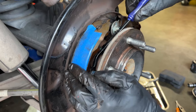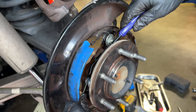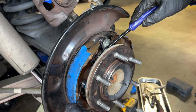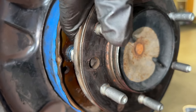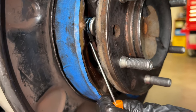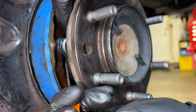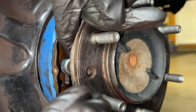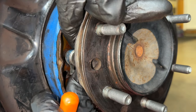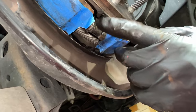I got it in. I put the pin and spring assembly in with my pick tool and then pull the tool out — it's in there. Now that the spring is in position on the shoe, I grab the hook of the back plate, push my index finger against the spring assembly so it doesn't slide out, pull it into position, and snap it in place.